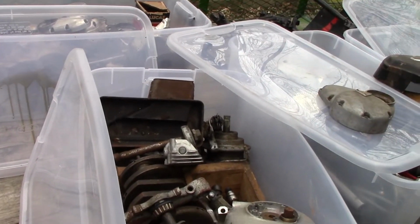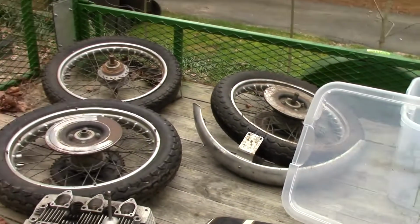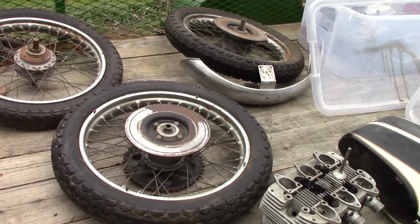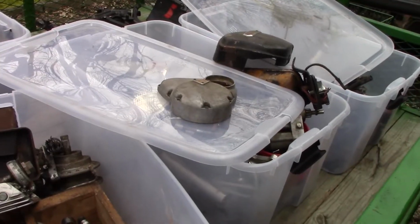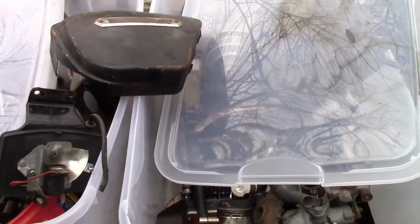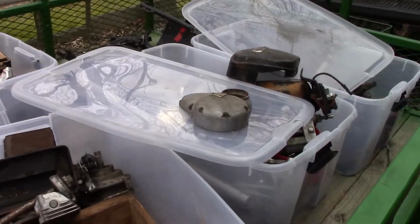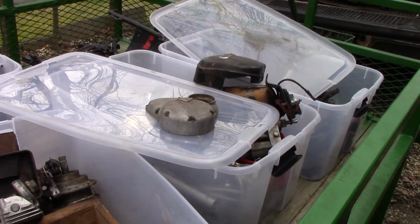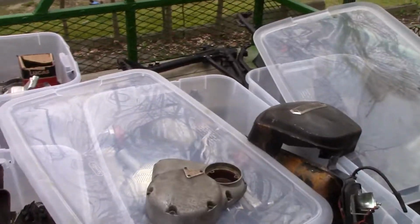We have started on a mini Indian project that is going to be interesting because I'm actually going to have some machine work on it. I'm going to bore it out to accept an oversized piston because standard size pistons are not available for it anymore, and it needs a new piston. I'm going to make some bushings for the swing arm. That's going to be really simple machining work in some plastic. But the cylinder is going to be interesting because I've never done one before, and we have 2 of them, so I'm willing to give it a shot. I want to try it. It's not a huge thing. It's 50 cc, one single cylinder, and it's got to come out, I believe, 0.6 of a millimeter, something like that.